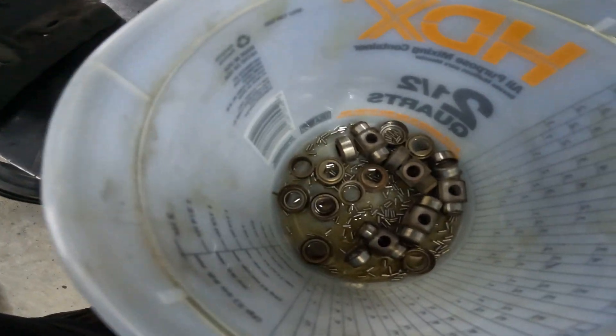If you don't know what a trunnion upgrade is — on an LS rocker arm you have these little roller bearings inside, and the center part is the trunnion, which rides on those roller bearings. Nothing holds the caps on other than an interference fit, so these little caps are known to come off and send tiny roller bearings all through your engine. There are a lot of them — little needle bearings just rocking around in your engine, which is not good.